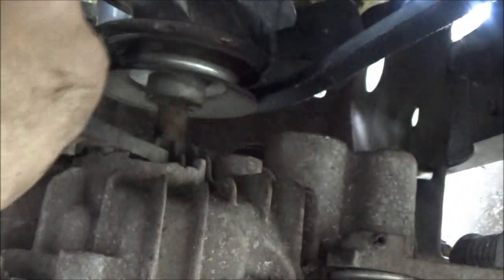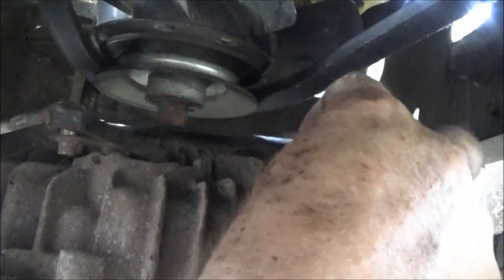So remember, that piece that holds the clutch in place, do not straighten it. I got to looking at it, and it didn't look like it was a damaged bend. Then I remembered, I've done a few of these, and I think the first one I ever did, this is going back when these things were new, electronic clutches were like, wow, I got an electronic clutch. Well, back then, I remember I straightened one and it wouldn't fit. So I better tell you guys, don't straighten it.